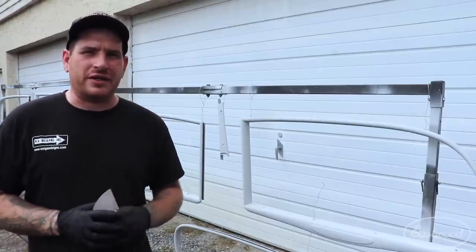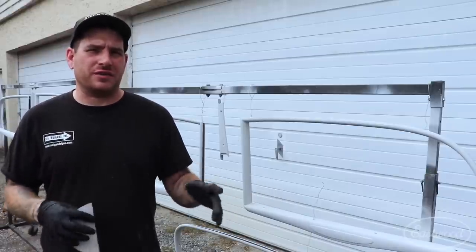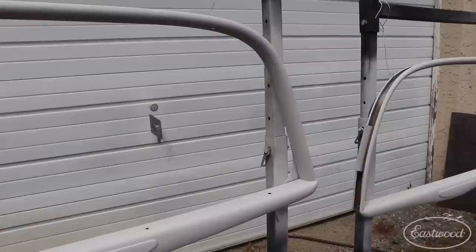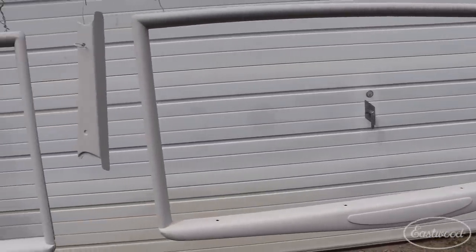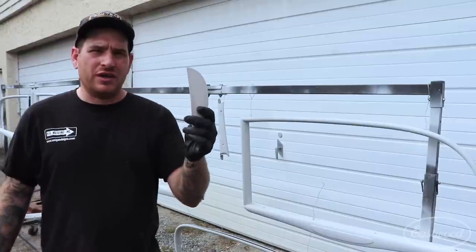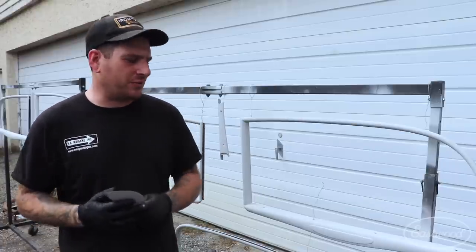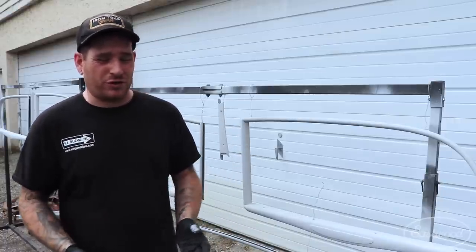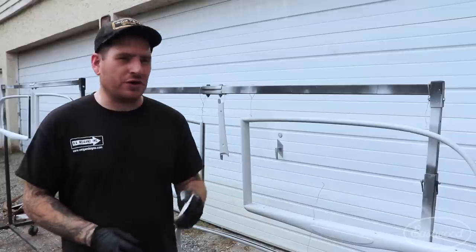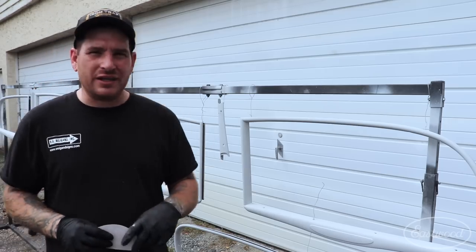Now that I've got the detail paint gun cleaned out, I'm going to let it sit for a few minutes and let any residual prep solvent flash off so everything is nice and dry. In the meantime, the epoxy primer is all dried — it's probably in the 80s today and I let it sit in direct sunlight, so it basically cured and baked. Now I have a piece of 600 grit paper and I'm just going to lightly go over it to take off any texture, nibs, or anything like that. 600 grit will smooth everything out but still leave enough texture to lay paint over top, and then we're ready to mix up some paint.